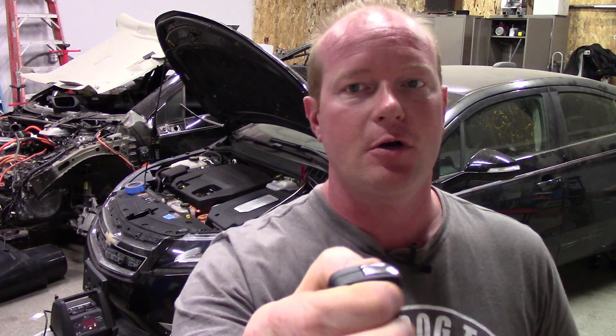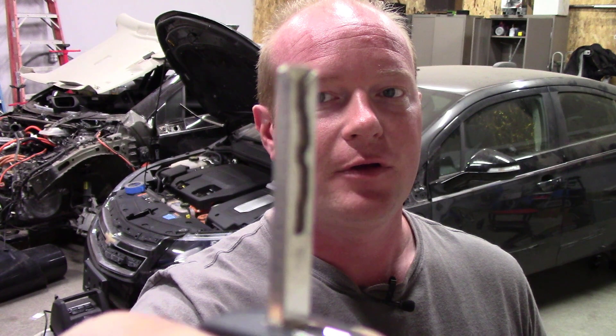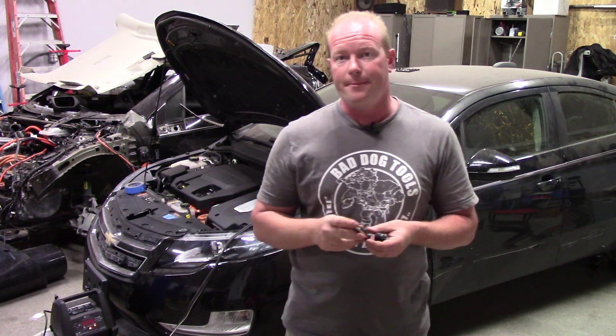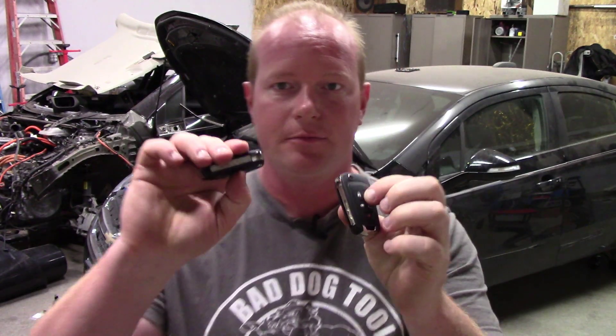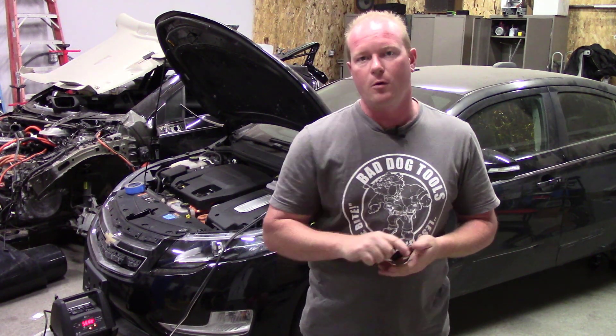These are OE keys I purchased through my locksmith supplier. I went to the dealer and got the key cut codes, then had a friend with a key cut machine cut them for me. These aren't just normal keys — they're flip keys with a different style of cut, so you need a special key cut machine. The dealer could have done it, but by going through a locksmith supplier, I saved a bunch of money on the pair. The problem is they don't do anything — when you push the buttons, nothing happens.